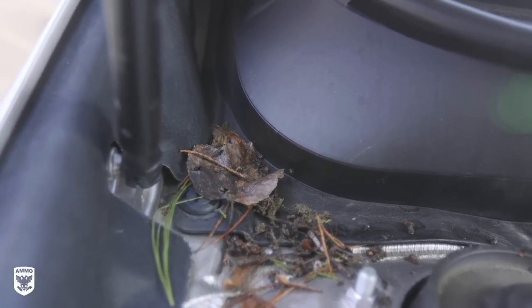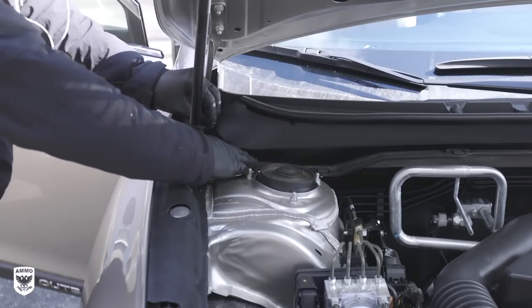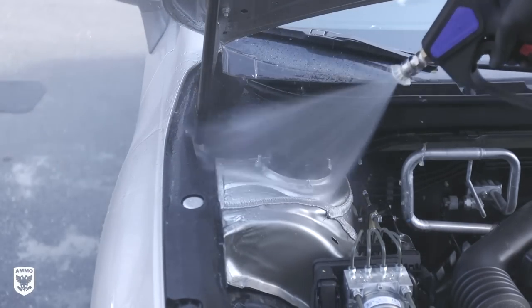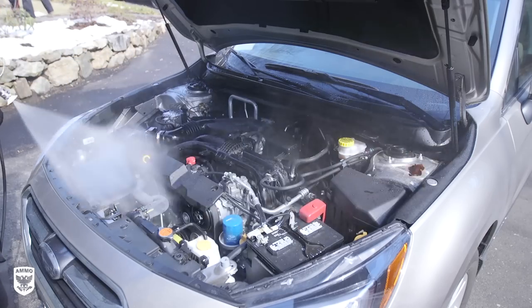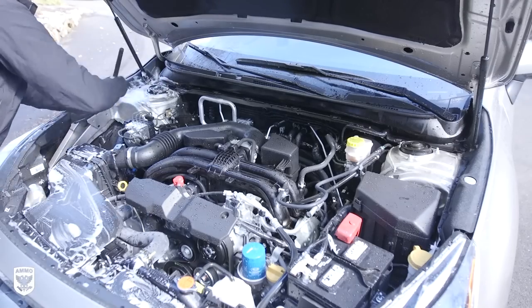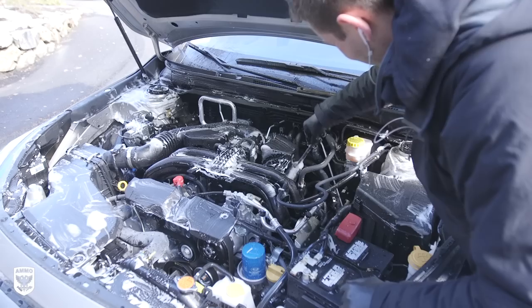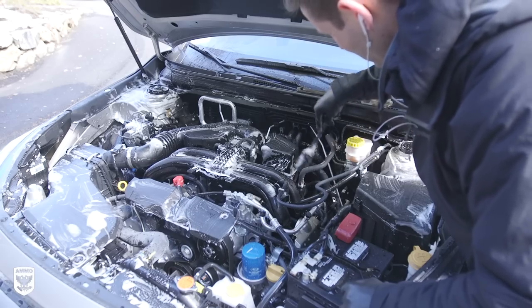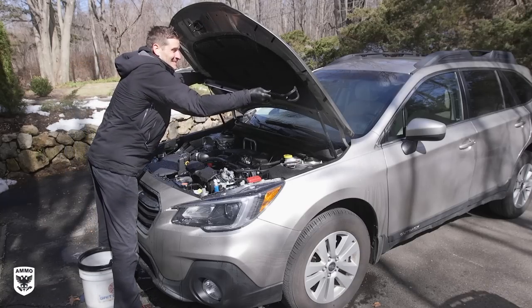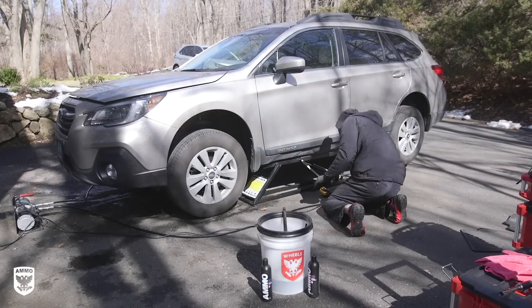Step one of an exterior detail is to work the engine first by removing any leftover sticks or leaves caught up in the jams. You do this by hand, otherwise it will become a muddy mess that goes all over the windshield and paint if you decide to do it with water first. Then lightly rinse the engine and use your wheel brush and wheel soap to clean the jams and the dirty areas of the engine. Be sure to cover any sensitive engine components if necessary. For tight spots, the small wheel woolly can also be helpful. Then rinse, remove any extra lights, close the hood but not all the way, and don't dry the engine at this point — save it until the end of the wash.